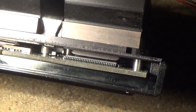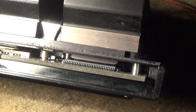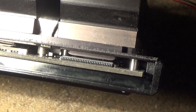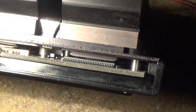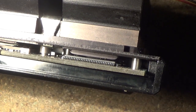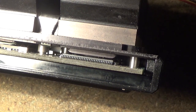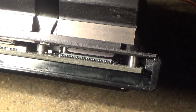I'm going to do my best to get this for you, but there's actually a design flaw in the older, larger cartridge design like this, where that heat spreader doesn't touch the cache chips. But you'll notice those cache chips are unusually thin. It makes me wonder if maybe Intel changed them at some point for thinner ones and then just never updated the heat spreader.